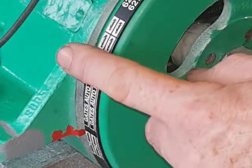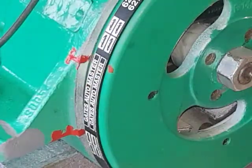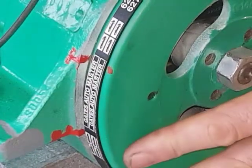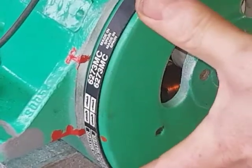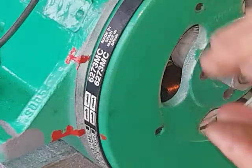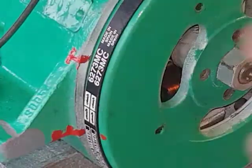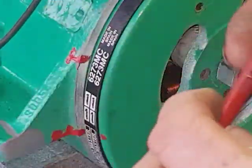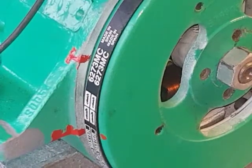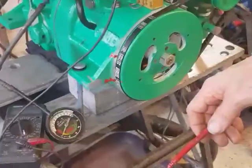The dent should appear here at top dead center for either the 7 or 12 engine. The 7 horsepower fires at the bottom of the buttress, which equates to 30 degrees earlier. Visually, if you looked at the contact breaker it would just be starting to open as the flywheel goes clockwise, but we don't need to look because we can use the buzzer.